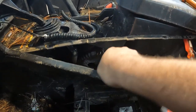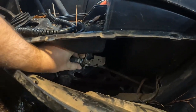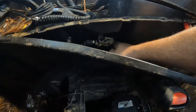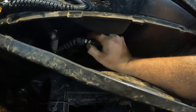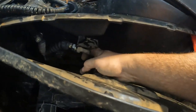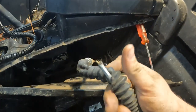They don't give you much room in here, so if you got a short stubby wrench it'll probably make it easier. I'm going to loosen that nut just enough where I can pull this sucker out of here. Now that's got it loosened up — yeah, come out just like that. Pop it off the end over here. There's our broke shifter cable.